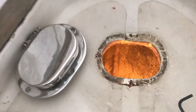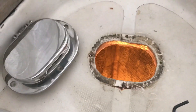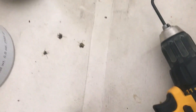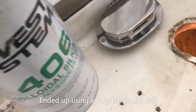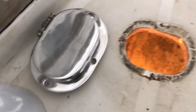Installing the hawse pipe here, I had to enlarge this hole because the old one was a little bit smaller. I got this new one — the cover locks in the open position. I did the allen key trick to remove some of the core. It was a little challenging because it was epoxied plywood and really tough to get out, then I filled it with thickened epoxy 406. It should be nice when it's done — this is a nice shiny piece.